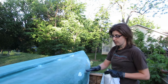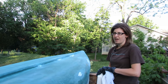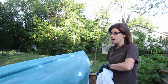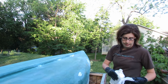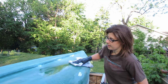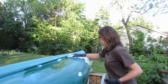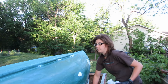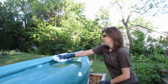The next step after I've sanded everything down nice and flat is to get the dust off prior to painting. Today I've got some methyl hydrate so I can get the dust off and it's going to evaporate quite quickly so that I can paint later on. I could use water but then I'd have to make sure it was really, really dry. I'll just wipe it like that to get off that fine paint dust and epoxy dust to get ready for the paint job. Look at how fast that's drying - it's great.